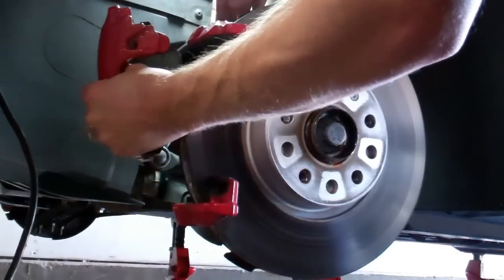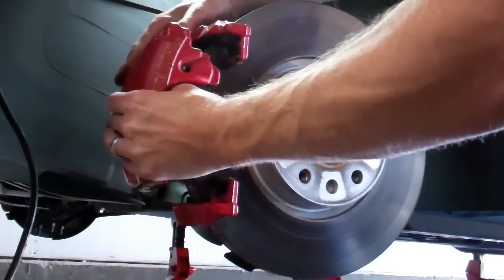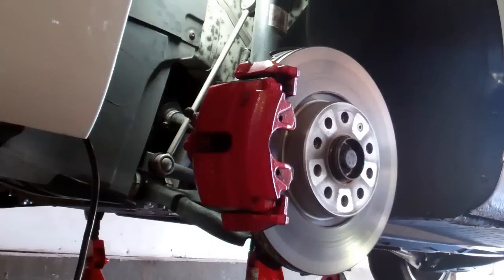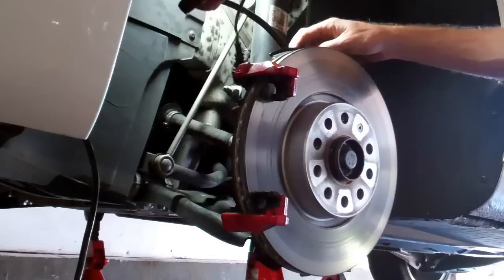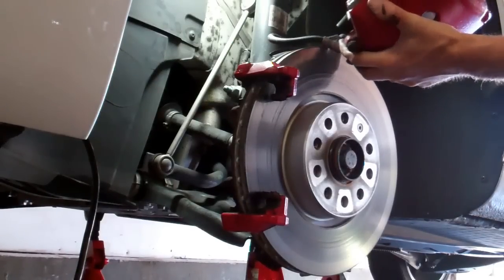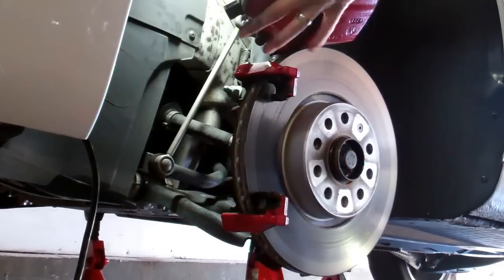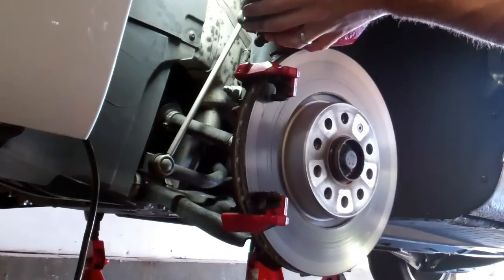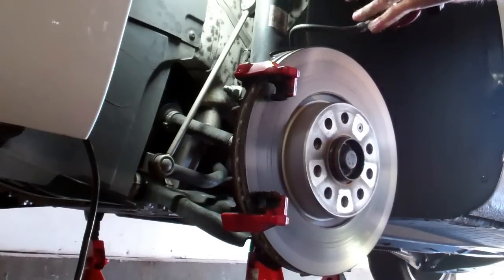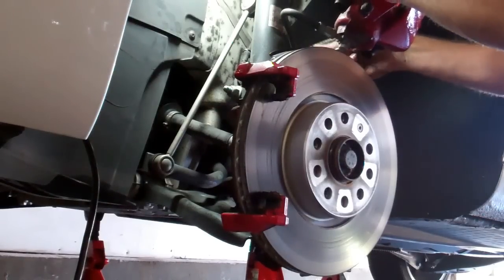I should have done this first but I forgot to disconnect the harness wire from this connector here so I can pull it out. I'm going to gently lay it back and do the connection properly just so I don't rush or break anything. To find it in a somewhat comfortable way, you can pop out your pad first, which has little clips on it that snap inside your piston. Then without bending my line too much, I'll find a comfortable place to set this caliper with the bungee cord.